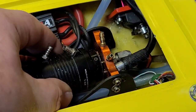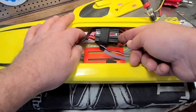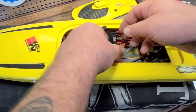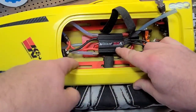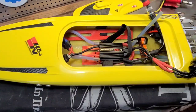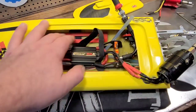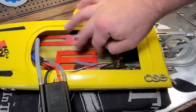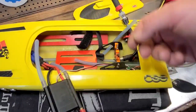This mount right here I can slide the ESC back and forth. I use velcro on my ESC. I can move my ESC down to this position. I've got a battery strap, battery tray here and battery tray here, and I put my ESC on the bottom — down there I can run 6s in the boat with double batteries. I'm going to put a velcro strap right here so I don't have to worry about zip ties — I can just velcro the batteries, done.